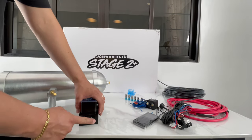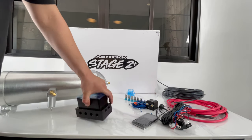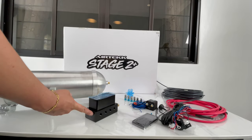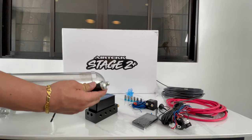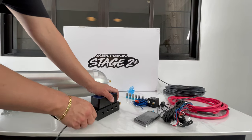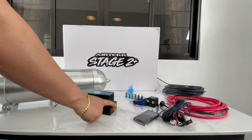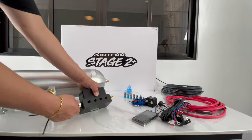You're going to notice you have two ports on each side of the water trap — you have an exhaust and you have an inlet, same thing on the other side. You have an inlet feed going right over here — it doesn't matter which side. From the other side you can just plug it, or you could also do this: if you want to put the pressure switch, you can actually screw it right on the side right over here and you'll still be able to repressure.